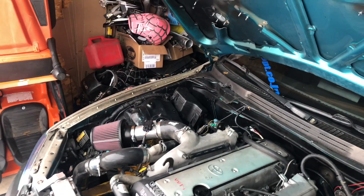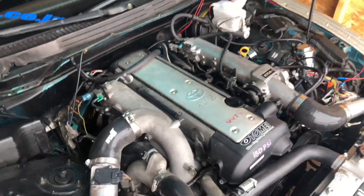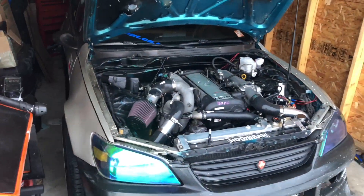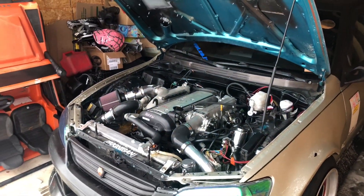I'm going to use my extra turbo elbow, cut the flange off, get rid of that stock elbow, and make my own downpipe — I should have done this a long time ago. Then I'm going to go three inch all the way out the back, and it should sound great. Sorry this is a short video, but I do have parts coming so there will be more content soon. I hope you guys like it — leave a like, hit subscribe, and we'll see you in the next video.